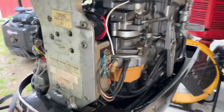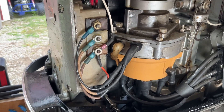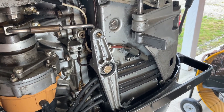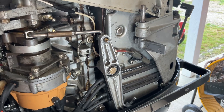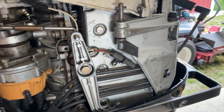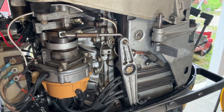Looking at the engine towards the stern of the boat, this would be on the right-hand side. You'll notice there are two other connections there — I would recommend removing those. There's a white connection that goes up and over to a switch — that's your tilt switch. It's an interlock feature that de-energizes your ignition in the event that your motor is tilted past 45 degrees. What it does is, once it gets above 45 degrees, when that switch goes level, that mercury switch makes and shorts that whole connection down to ground. Take that off for troubleshooting, because you could have a bad switch that's just made all the time.